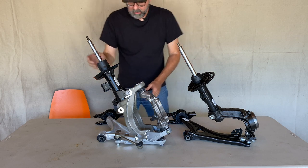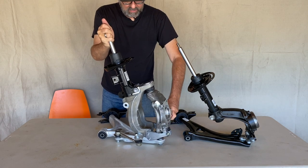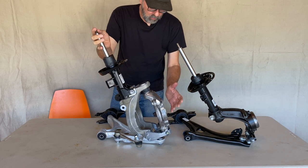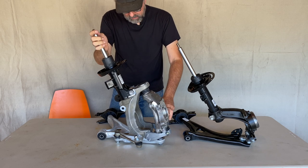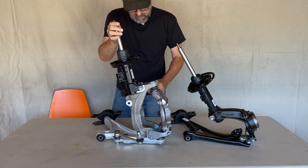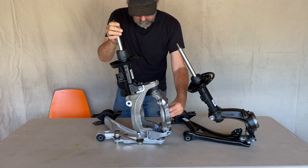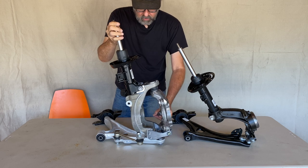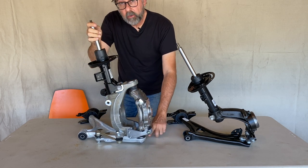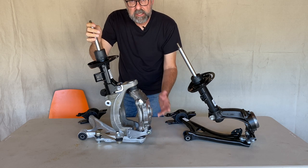Contrast that to the Type R, which has a separate steering axis, and you can see that the geometry is quite a bit different — and that was why they went to all this trouble, in order to optimize the geometry so they could put over 300 horsepower to the ground and have it be manageable and fun to drive. What this does is create a different steering axis between this point and this point, and they've arranged the geometry so that imaginary line goes through the middle — or pretty close to it — of the CV joint, which turns when you turn the wheel. That small offset reduces the tendency towards torque steer. If you project that line all the way to the ground through the tire, it'll be close to the center of the tire's contact patch, and that also reduces the tendency for torque steer.